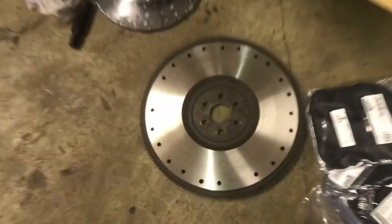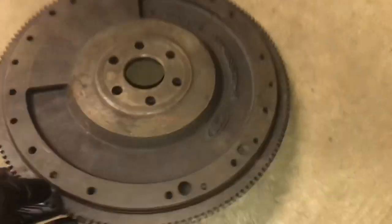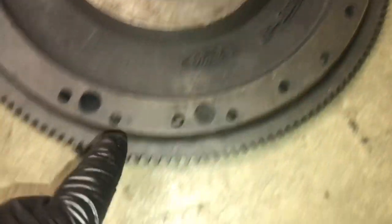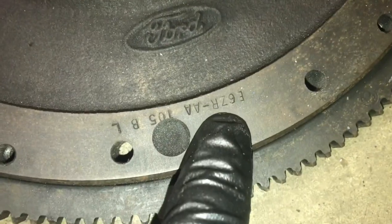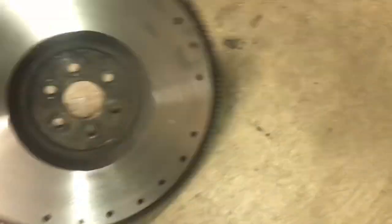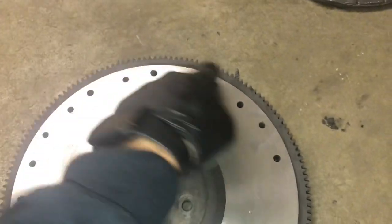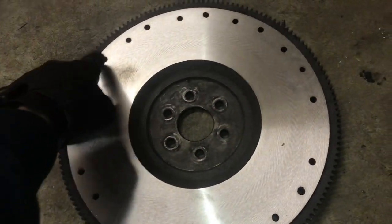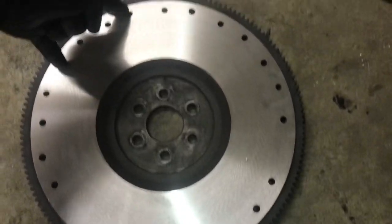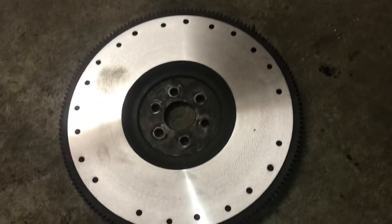Moving on — the V8 and 2.3 flywheels are obviously different. This is a V8 flywheel. Don't pay attention to the E1ZR stamp — pay attention to the number E6ZR-A. This is a 50-ounce factory V8 flywheel, 157 tooth. The six clutch bolt holes are evenly spaced on this one. On a non-world-class 10-inch clutch setup they would be grouped two-two-two instead.